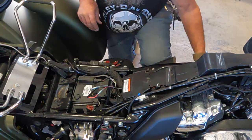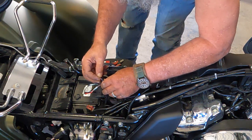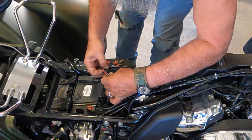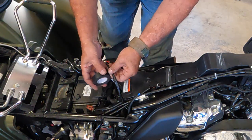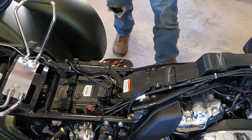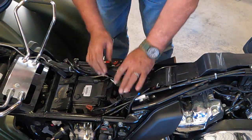I do believe that's going to be switched power, so for the time being I'll just fold that purple wire back in here since I don't have any use for it, and put some electrical tape around it to protect it. That's it for the electrical connections down at the battery. Now we have to change out the grip on the throttle side. Tuck these wires out of the way just like so — that's all there is to that.